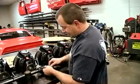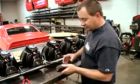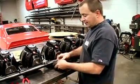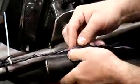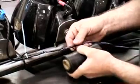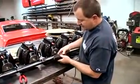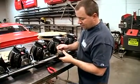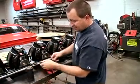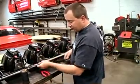Okay, as I previously showed, I twisted all the wires together after I added this one, so now we have 6. Now on a bigger bundle of wire, I will use a lacing string, which is used in aircraft stuff, and that'll just keep it twisted together under the heat shrink while I'm doing that. Because when you're trying to stick all these wires in the heat shrink, they all kind of try to untwist themselves. This cord is like nylon, with a wax paraffin on it, and it's what every airplane's wiring harness is held together with. And I use it under the heat shrink just so when I push the heat shrink over, it doesn't bunch the wires up.